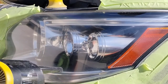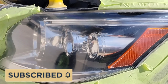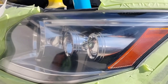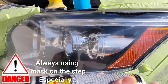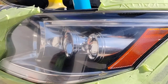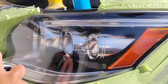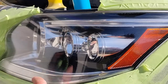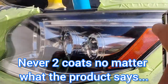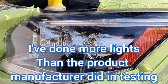If it's made for headlights, the clear coat is self-leveling and filling. This is just the third checkpoint — the one before this would have been after the 3000, and another after the 800, just to gauge where things are at. Always use your mask during the spray step — this stuff will really mess you up. You'll have a bad week if you breathe it in. If I see a problem area right there, I'm just going to go ahead and redo it before I spray, because once you spray it's there and it's harder to take off. You don't have to do the whole light — just that one area.